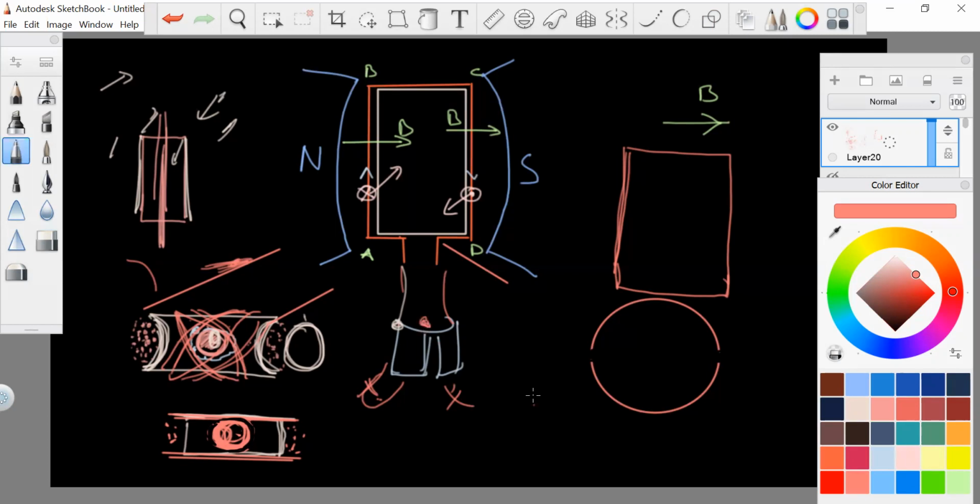If this is not centered, then what is going to happen is, let me show you over here. This is slightly not centered. So how far is the carbon brush over here? This far is the carbon brush, right? Now, when this part comes on that side, it might not touch the carbon brush. That is one issue, a connection issue. Secondly, this whole thing will be shaking and wobbling a lot. It is going to wobble like this. Got the point?